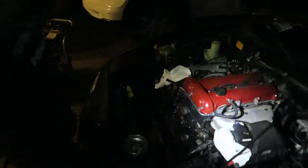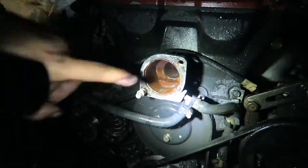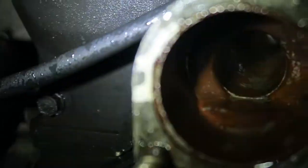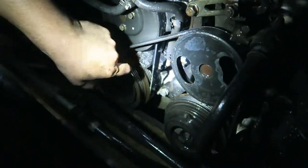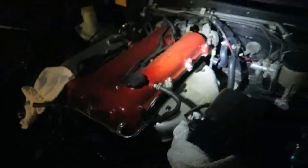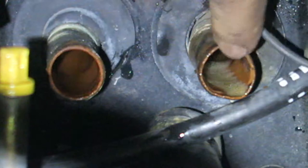We cleaned out and flushed a bit of it. The pressure washer was strong enough to clear some of this out. I can still see it's kind of orange-ish, but that's years of oxidation - it's truly almost never going to come out completely unless you're power blasting it. As long as the water comes out clear from the bottom hose you're fine. We also pressure washed that area so it looks a lot less oily - now we can tell if there are oil leaks and where they're coming from.